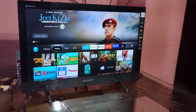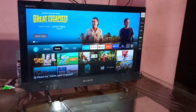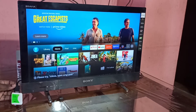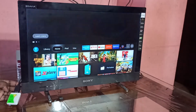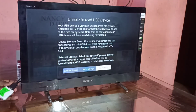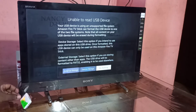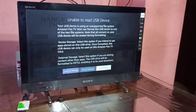When we connect the memory card reader with the memory card to the USB port of the Y splitter cable, you can see a prompt in the Amazon Fire TV stick UI. Now it's reading the memory card. You can see the message, and at the bottom there are three options: external storage, device storage, and do nothing.